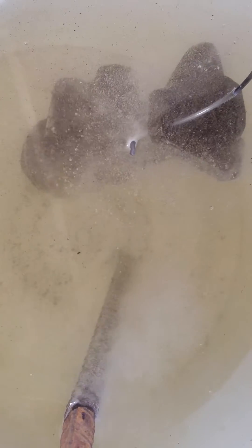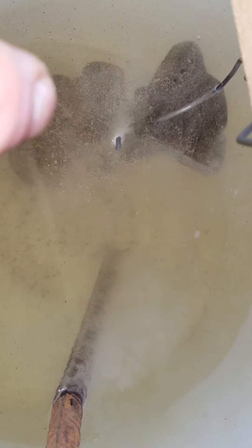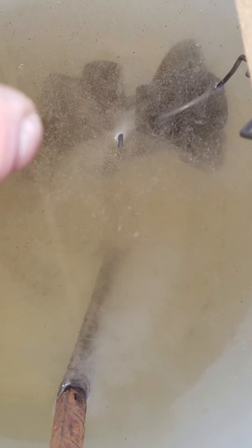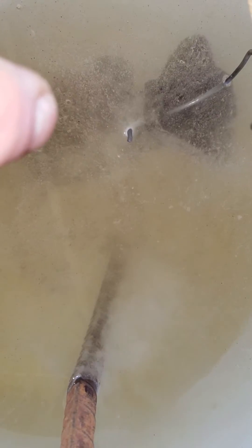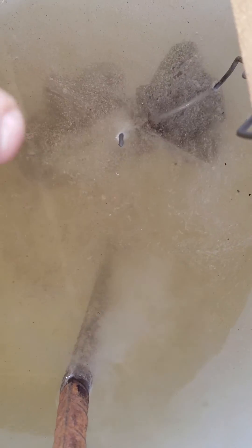They will go merrily along and the rust will be destroyed on the part where you want it destroyed, and it will be transferred — it's kind of the opposite of chroming. It's de-rusting: separating the iron and the oxygen from the rust and sending it to the positive side. The flow of electrons is from negative to positive, so it's going to take all the rust, paint, dirt, and crud off the old master cylinder and transfer it to the sacrificial rod.